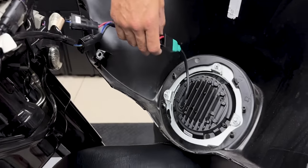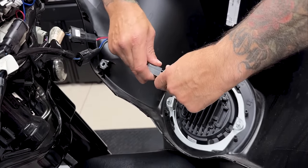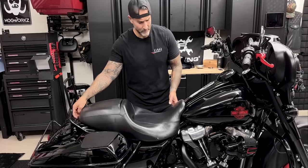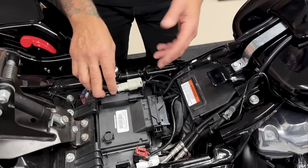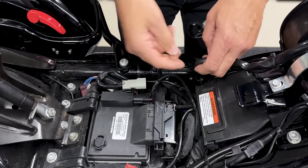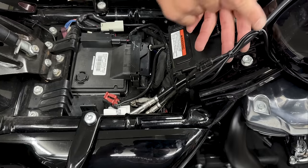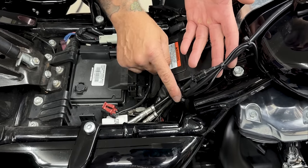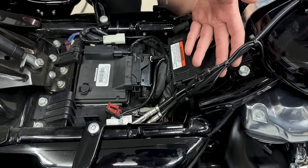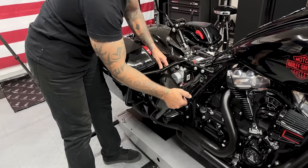He's got an aftermarket headlight with an extension — just disconnect it here. Now I'll remove the seat and then the tank. Disconnect the gray connector leading up to the fuel tank, and also disconnect the vent hose. You'll usually have a couple zip ties on your overflow hose — cut those carefully, making sure you're not cutting any other wires, then just pull that hose out. Loosen up the bag so we can get the side cover off.